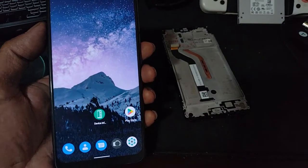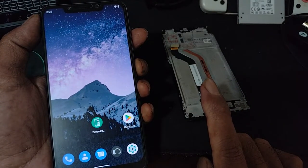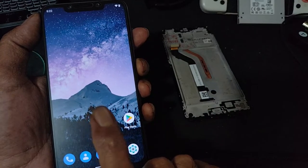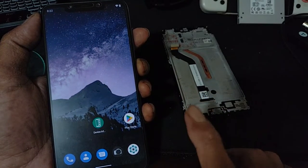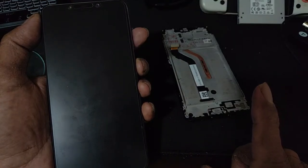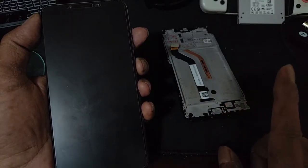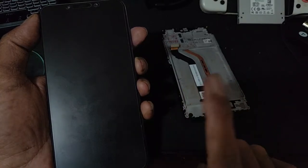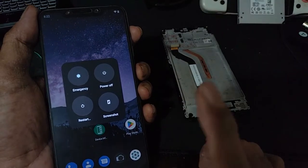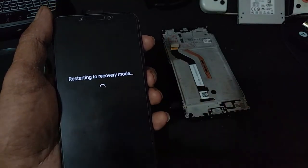Before this, the driver was not available for this one, since the RC1 doesn't have the NT36XX driver for Novatek. Get the NT36XX from the RC2 driver, and don't use the RC2 itself. Move the NT36XX from the RC2 to the RC1. Use the RC1 driver, because with the RC2 you will surely get a BSOD, blue screen of death. Okay, we start the recovery to switch to Windows.